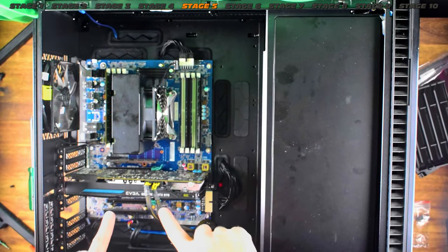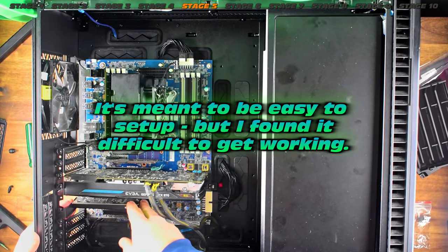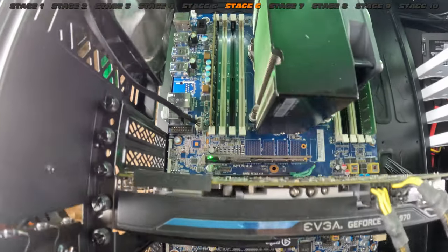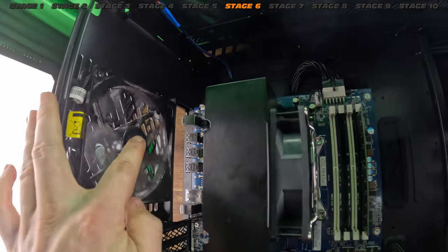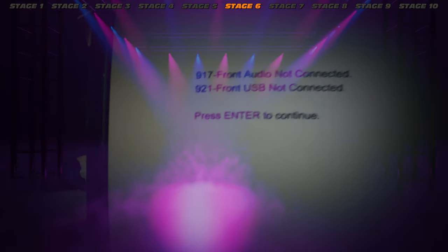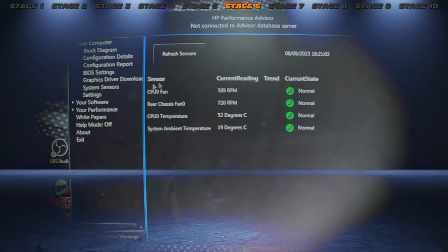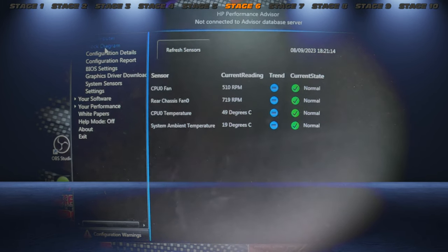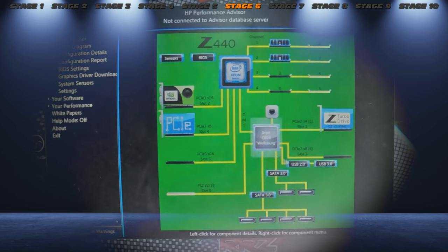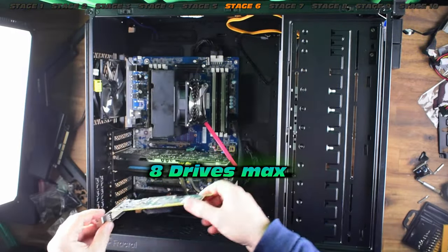Why this particular GPU? I'm going to record 4K footage on this every once in a while — very handy being your NAS storage device. Let's do a quick boot test. Power it on — wow, that fan is really noisy. Sounds like the bearing may be shot — just as well I caught that. We'll replace it. A couple of errors because the front IO signal was not as HP intended it, but nonetheless if you can deal with pressing a key you can survive. CPU is surviving and we've got everything there on the 1620 CPU for now.